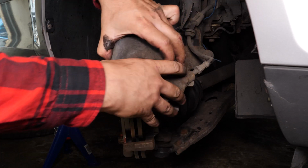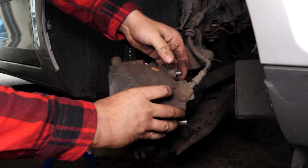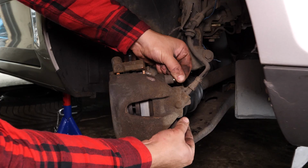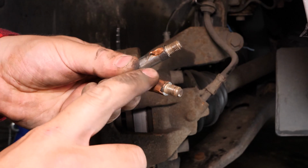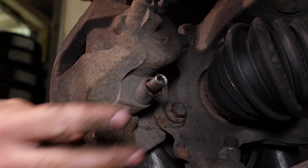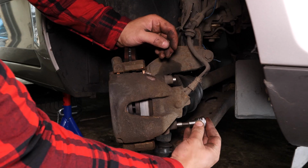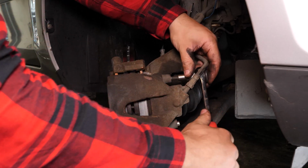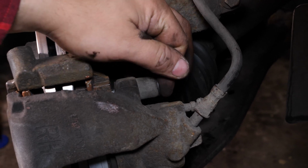Put the brake caliper in place on the brake caliper mount, pushing it in as far as possible. Grease the 2 caliper mounting bolts, then screw them back in place, ensuring that they're properly in their housing. Finish screwing with a socket wrench and a 7mm Allen socket. Put the caps back in place, clipping them in as you do so.